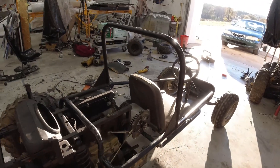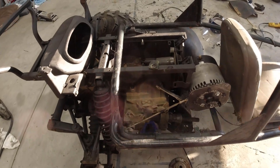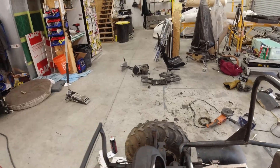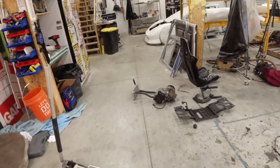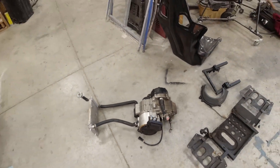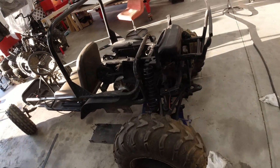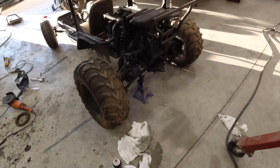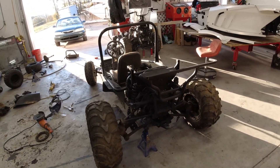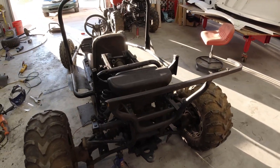As a sneak peek at the powertrain options, you can see there is a motor in there — we'll go over the power strategy once the frame is complete. There's also another motor over there that I've been hinting at for a while. That motor is rated at 40 kilowatts and that one's rated at 32 kilowatts — so you can get an idea of what kind of power we're looking at pushing this thing down the road. That's nominal voltage — I plan on exceeding those power ratings by as much as possible without blowing stuff up, as you know I can do.